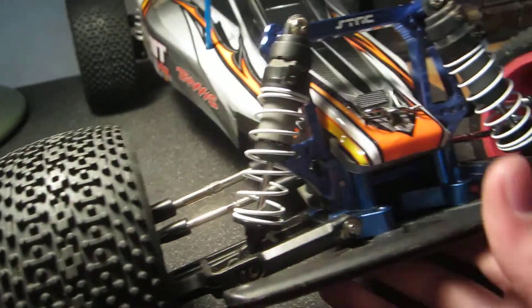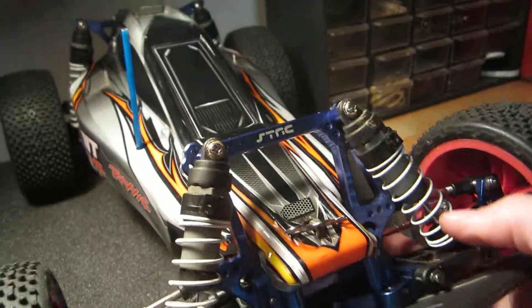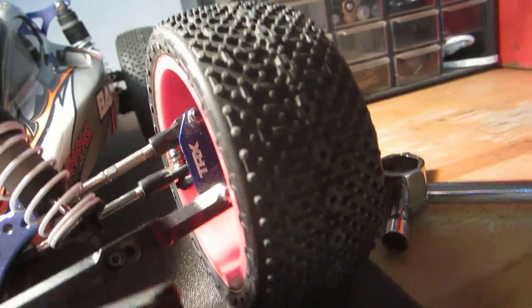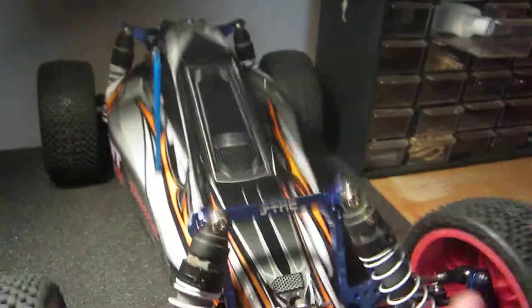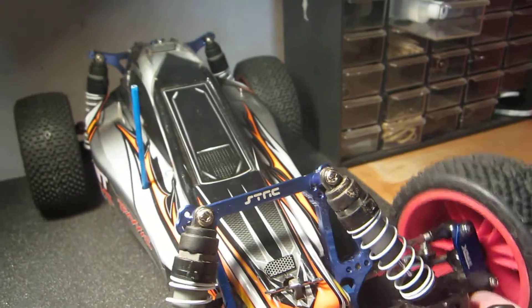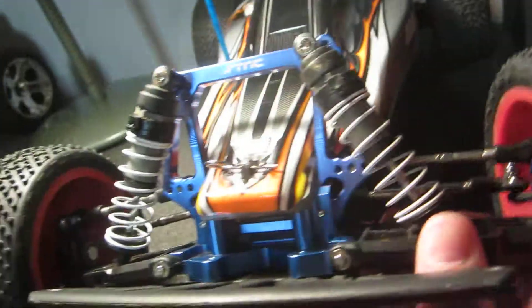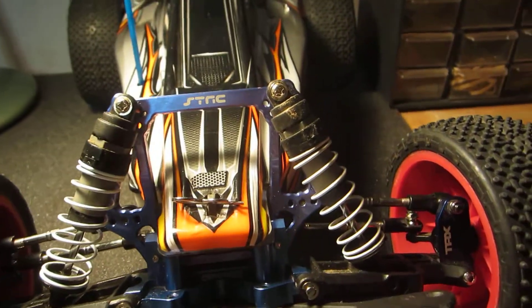The reason why it uses oil is because it's very smooth. When you press the shock down and you're going off a jump, you want the landing of the car to be smooth. The whole purpose of the shock is to keep the chassis and the body straight. You don't want the car bouncing like this — you want it absorbing at the tire, because the body's not moving, it's just the tire and the lower control arm that's moving. So that could be another reason why your shock is sounding like that.